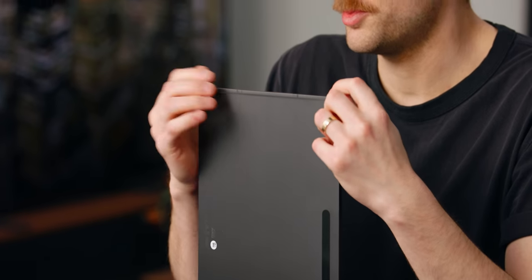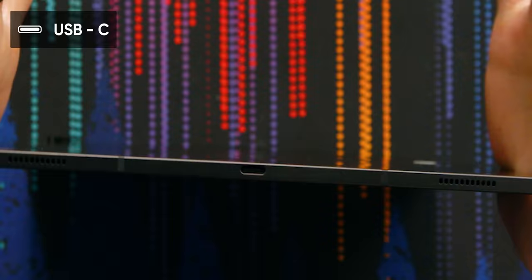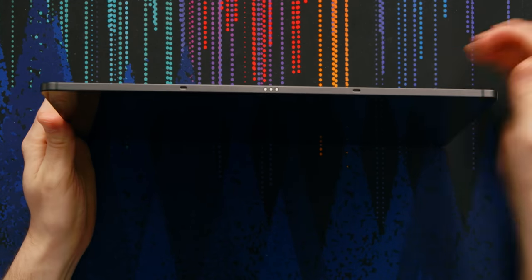On the bottom — I mean, tablets are confusing — there's two speakers over here and I guess two speakers on the other side, so there's four full speakers in this one, just like the iPad Pro. There's a USB-C port, which we've determined is USB 3.2 Gen 1 — that's five gigabits per second, not the 10 gigabit one. Hey USB, figure out your naming. Like it's not irritating to me until I actually have to deal with it again, and then I have to find out how fast the USB port is and I'm like, this is stupid. On the bottom we got what looks like Samsung's version of a smart connector for accessories.